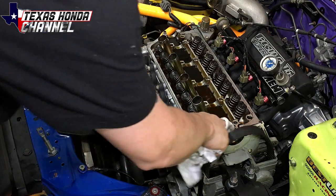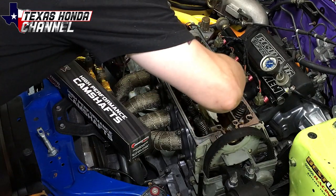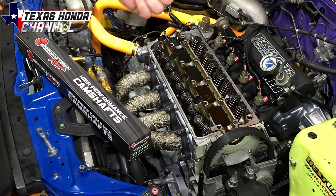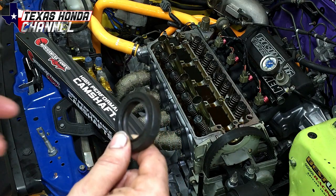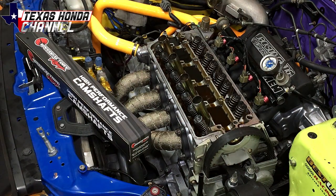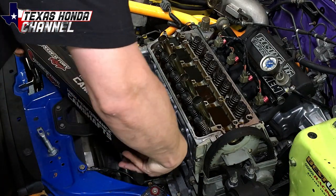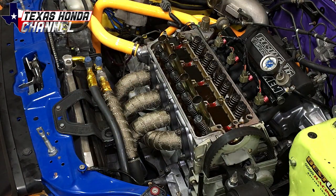This is another important area you need to make note of. These areas definitely need to be checked to make sure there's no serious scarring or pitting, because that can ruin the camshaft. Now, even though the seal is new, I like to use some black gasket maker around it inside and out so it just doesn't leak. And I don't go light with the assembly lube — I put it on pretty thick, because why not?